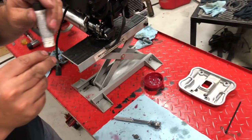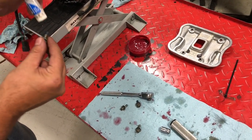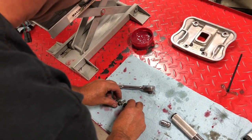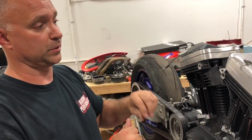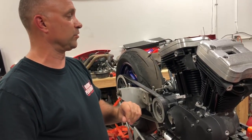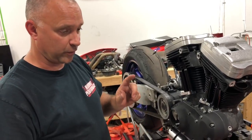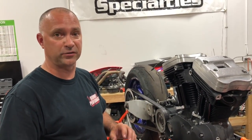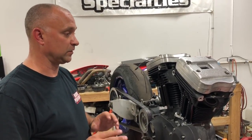So again, you'll want to double check on this rear one to make sure that you're not hitting. If we're dealing specifically with the 86 to 03s in the four speed. On the 04 and laters, it's a two-piece cover, so it's set up a little bit differently. There's a little more space between them instead of the three-piece cover. So 86 to 03 is really the ones you want to be concerned with to double check, to make sure your rocker arms aren't hitting your tops there. Other than that, the 04 and laters are usually pretty good, but it doesn't hurt, especially on some of our higher horsepower builds, 110 horse, 120 horsepower packages, that you clearance them anyways to buy you some wiggle room there. Again, color them with a Sharpie just in case we have noise and we don't know, that may be a possibility if it's a higher horsepower package.